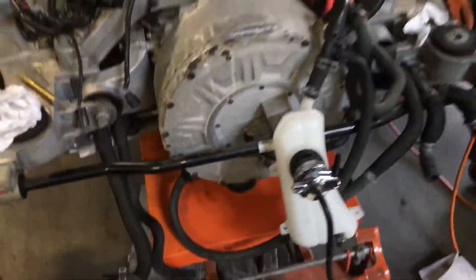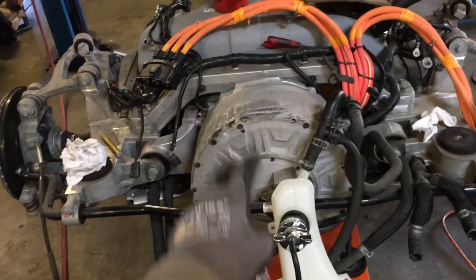We're getting into thermal management now. All these electric cars need a lot of cooling. This has its own cooling system, and they had no records on where this repair was done, but there was a crack that was obviously ground down and re-welded — here's the factory weld, here's the repair. But it had a leak again, and over here on the factory weld you can see that light crack in there; that's leaking like a sieve, and the crack is going all around. That's part of the cooling system for the electric motor back there.